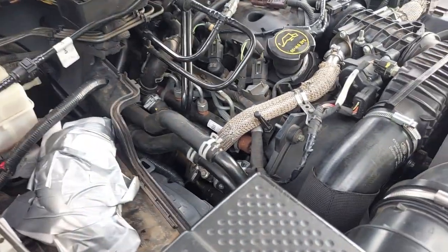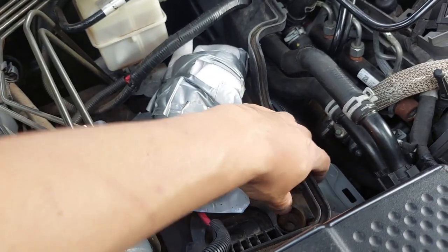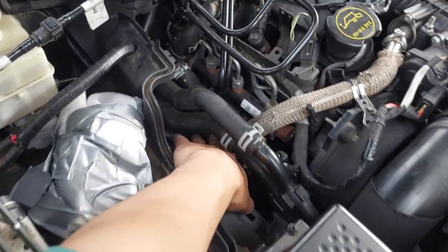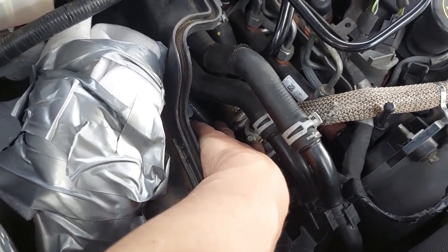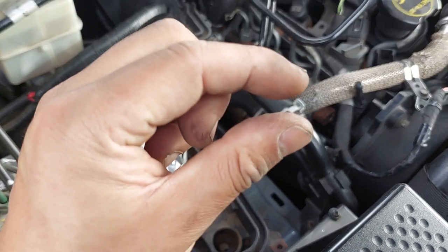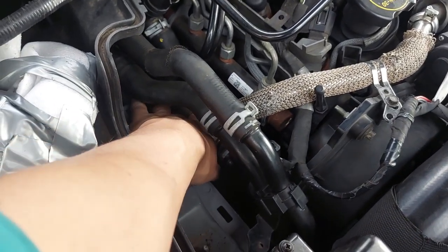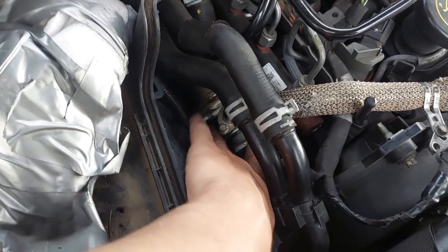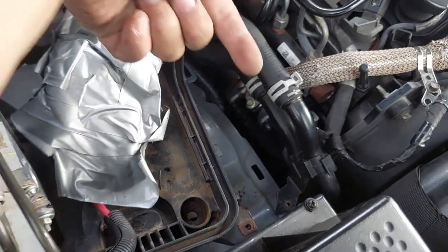I removed the secondary battery compartment to get access to the right-hand side EGR valve. It's as simple as loosening the bolt so you have a gap of maybe two or three millimetres, then very carefully not dropping the pipe. You slide the plate in from this side — not from the other side, because there's a valve bending there, so it has to go in from this side.